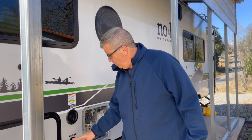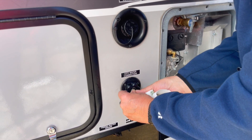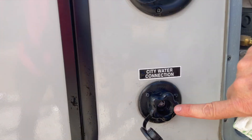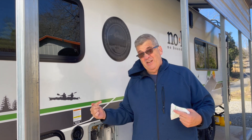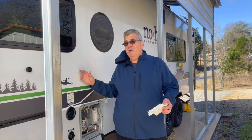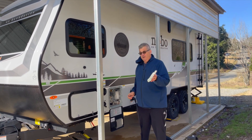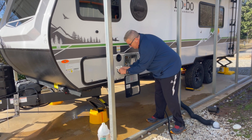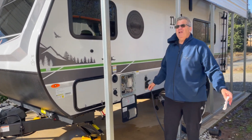My second-to-last step: the water pump is turned off and this is my city water connection. There's a little silver screen in here with a small white button inside — that's a check valve, it keeps water only flowing in one direction. When you push that check valve in, water will flow out this way. It's under pressure from the pump, so put a paper towel over it to catch the spray, then stick your finger in and press that button.